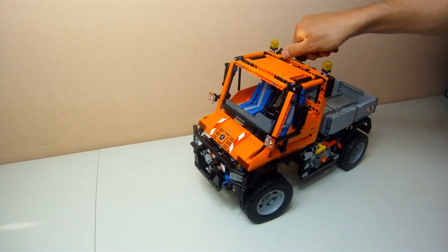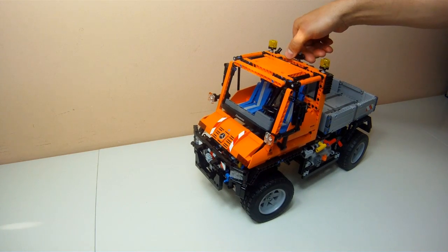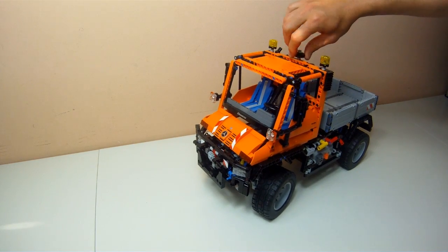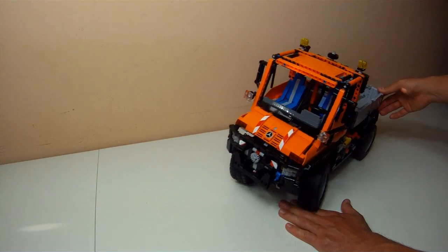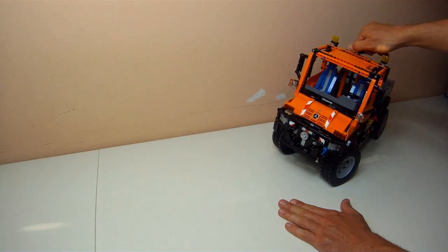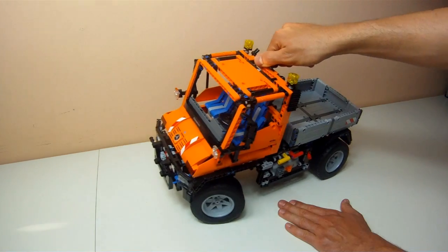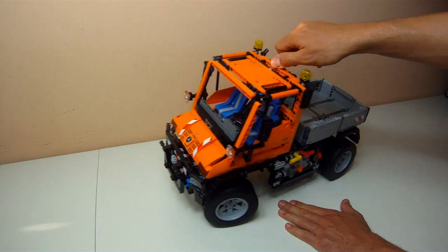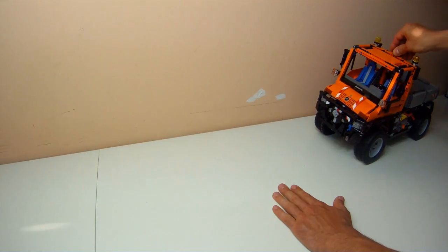Okay, so when we see the new setup in motion, we see that it goes very light. When driving over any kind of obstacle, it is pretty unimpressed by the bumps, and although we can observe a small deflection of the wheel at the initial contact, the wheel immediately straightens itself again, because of the correct geometry, which forces the wheels to point straight ahead at all times, just like in a real car.